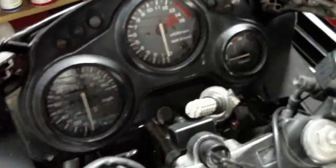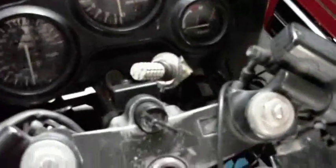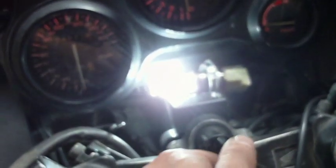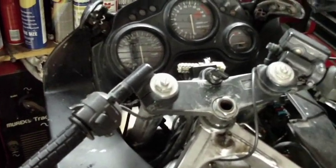On the old headlight, I had a bit of a problem with the dip beam terminals on there. The pin-out from the plug was shorting out the power, so what I had to do was pull out the little spade terminals and change them. Now that that's done — here we go. Main and dip beam don't really change anything, but power consumption should be a lot less. I'm going to go ahead and throw that in and see what it turns out like.